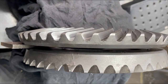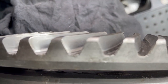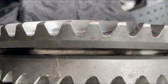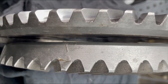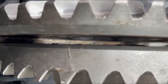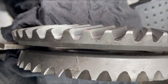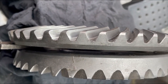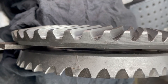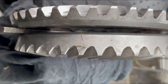This is a 110 Land Rover Crown Wheel and Pinion, and that is a Long Nose Land Rover Crown Wheel and Pinion. The base under the teeth is called the Land. Look at the difference in the thickness of these two crown wheels. What happens on these 110 crown wheels is they can flex very easily because the Land is so thin, compared with one that's nearly twice as thick on the Long Nose.